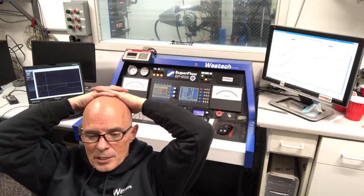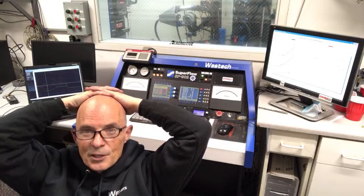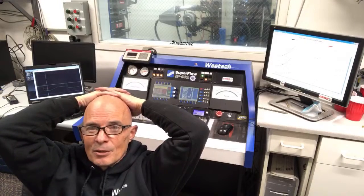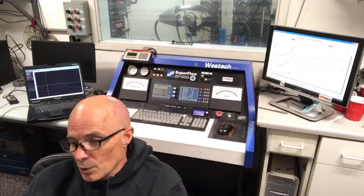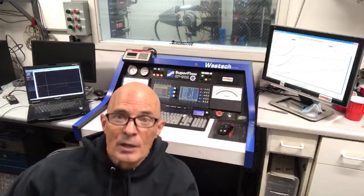Your carb question is you're trying to configure it as an absolute. You need the right jet in there. That's what you need. You don't need a richer, bigger or smaller jet. When you run a blow-through carburetor, you have to tune it so it works for your application, for the boost level that you're running, for the car that you're running. You have to tune that just like you do an NA carburetor. You have to make it work.